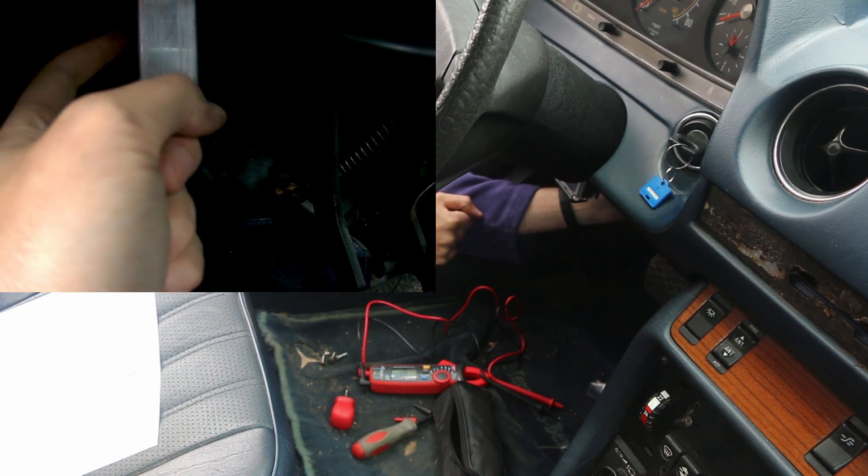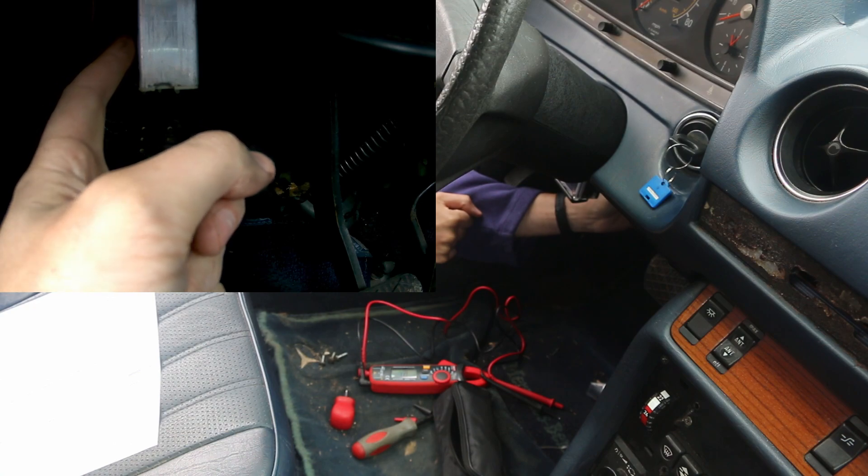So this amplifier up here has got to be our culprit. At this point you have tested the actuator, all of the wiring to and from the amplifier, and the control stalk — all of the circuitry there within. You know the brake control circuit is working, you know the feedback in the actuator is working, you know the solenoid and the motor are working fine. If everything is testing okay, the only culprit left is the amplifier itself, so to do much with that we're going to have to remove it and disassemble it.